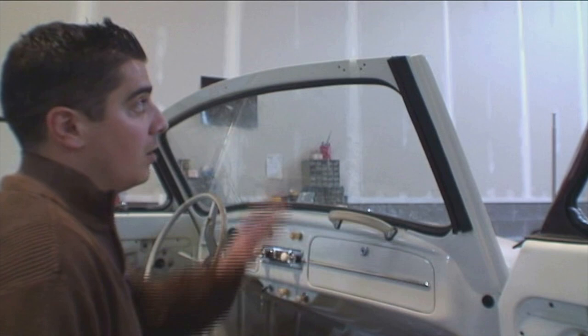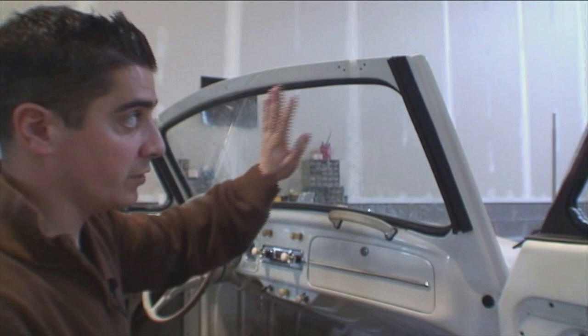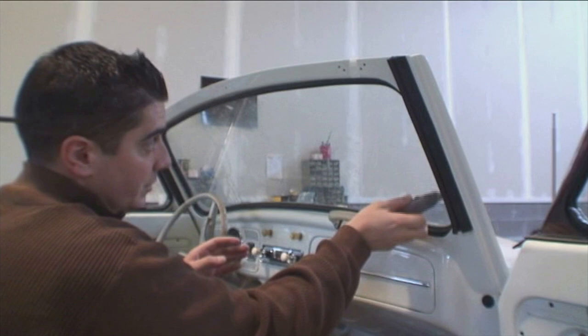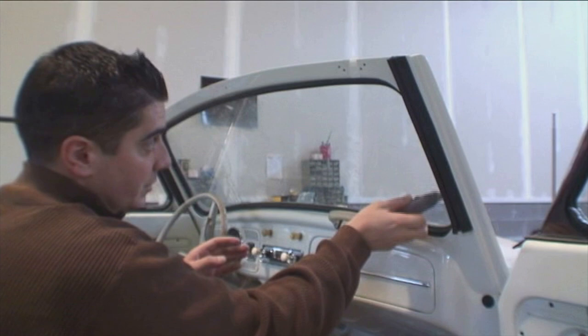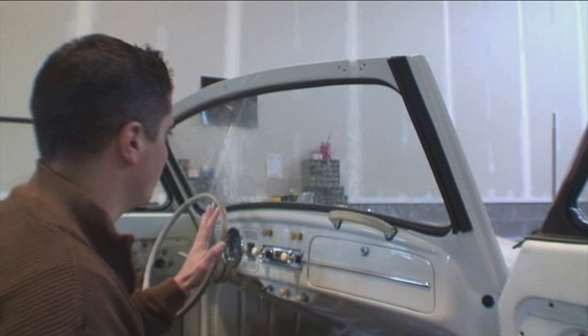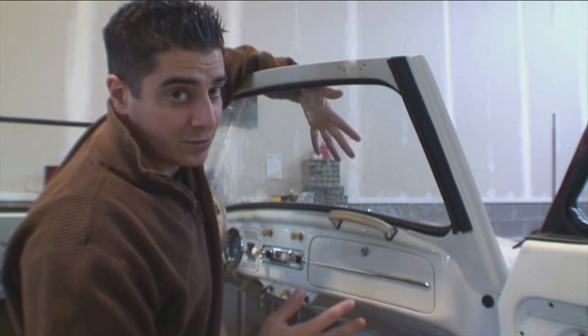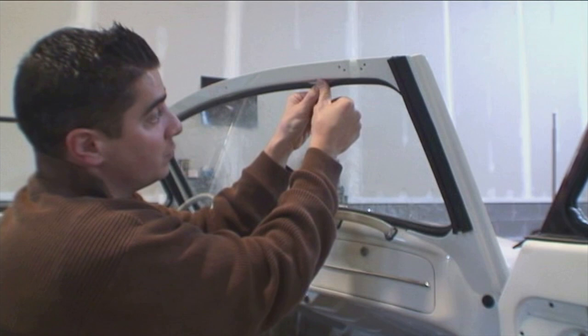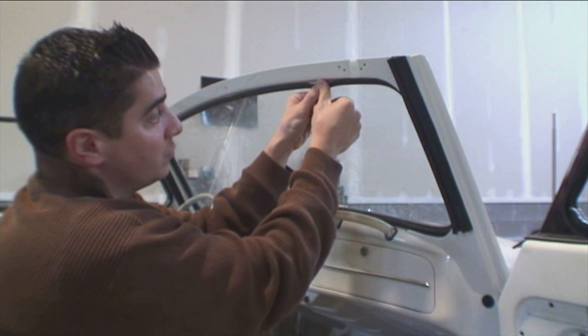The easy way to do this, if you want to change your seals, is to get your utility knife and cut the inside of the seal all the way around until the inner lip comes off. The outside portion of the seal is the only one left, and then it's easy to just push the window out. What I'm going to do here — and what you should do normally with a partner — is have your partner on the outside hold their hand against the window. While you gently press outward, you can fold one of the lips down like this, and once you pull that down and start pushing outward the seal will start to move and so will the window.